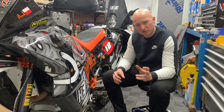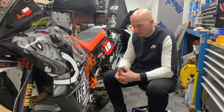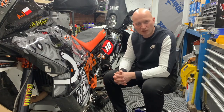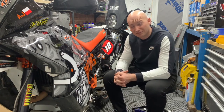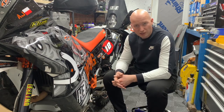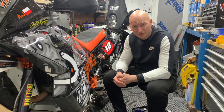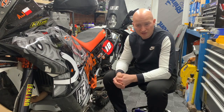And a slight tapping noise — like a tensioner tapping noise from the engine. Nothing really worrying at the time, but I got home and thought, well, this might be symptoms of water pump issues. So what I'm going to do now is put the bike on its side, take the clutch cover off, and see if I can find any traces of coolant in there — hopefully not. Or maybe that would be a good thing because we can eliminate that problem straight away.